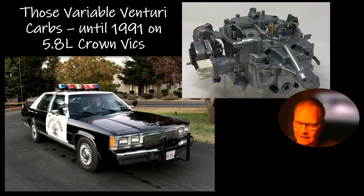We worked on their cars because they all had Fords. One of them came in on a brand new one that didn't have many miles on it and told me they didn't have enough speed and their acceleration wasn't great. To know what I needed to do about it, you have to understand how these variable Venturi carburetors operated. These things here would slide back whenever you applied the throttle — there was a big vacuum diaphragm at the back that would do that, with a ported vacuum. The problem was when you go to wide open throttle, your vacuum tends to fall off.